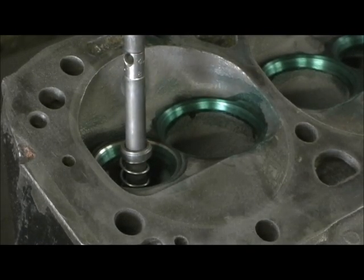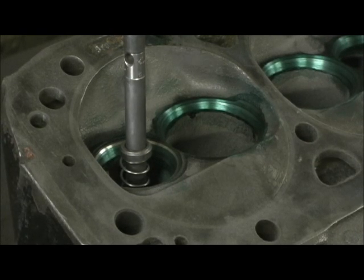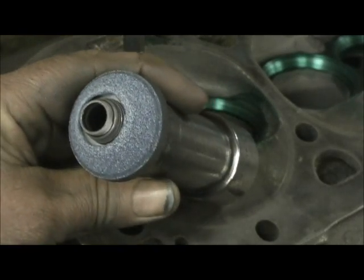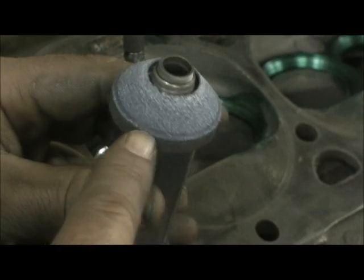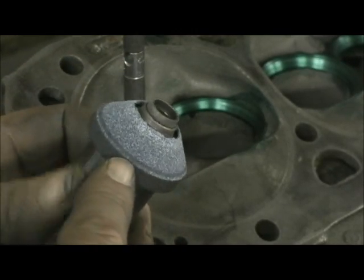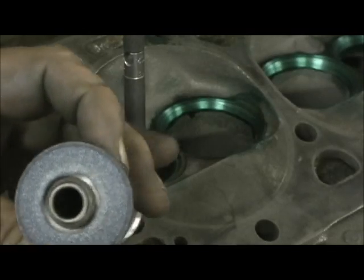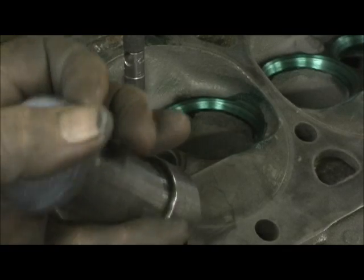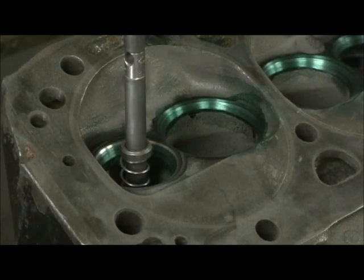As you can see, the 45 is the easy part. The valve job is indeed the 60 and the 30, which takes all the time. You just have to be very careful touching that last little bit, barely letting it bump and touch until you see the seat start to come in. Another good indicator — look at the stone. Notice how it's the same darkness all the way around no matter where you turn it. That's telling you the seat is round just by looking at your stone. If you've got black markings here and gray on the other side, you know you're out of round and you've got to go back with the 60 and 30 all over again.